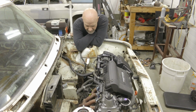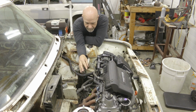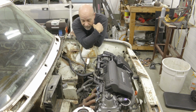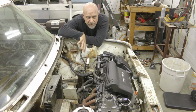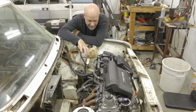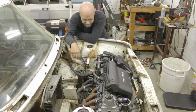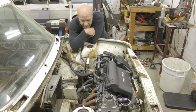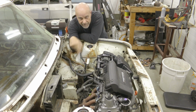What I've learned is that the exhaust, we'll do like a cutaway. I'll show you because I still have the actual Honda Fit that this came out of. The firewall differences, and despite a lot of stuff being almost identically laid out, there are some important differences. So I'll show you what the inside of the Honda Fit engine bay looks like. And frankly, what is probably going to have to happen is I'm going to transfer a lot of the firewall and possibly some of the floor pan that it transitions into from the Honda into this car.